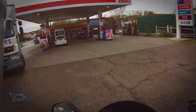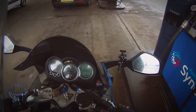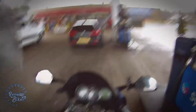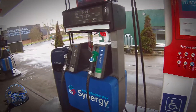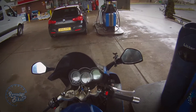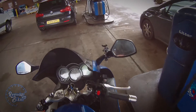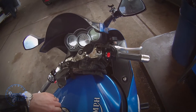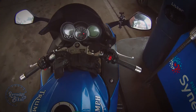At the moment I'm pumping out about 14.7 volts. It's all okay when it's cold. But as soon as it gets hot and the fan cuts in, the power drops to about 13.5 volts which is acceptable. But then as soon as you turn the bike off and switch it back on again, the only power you're getting out of the regulator rectifier is about 12.5 volts, which is not enough - for some strange odd reason.